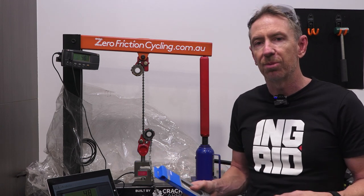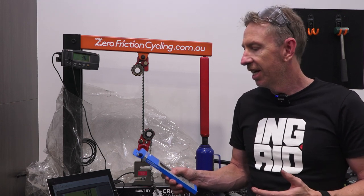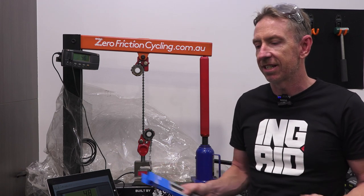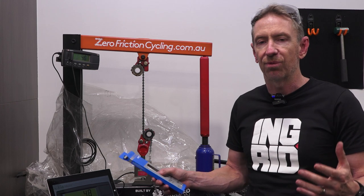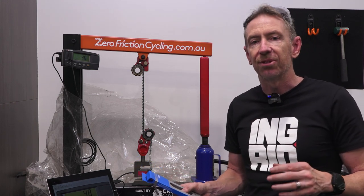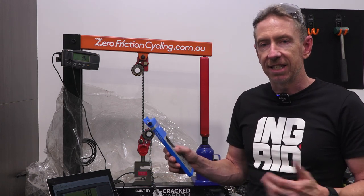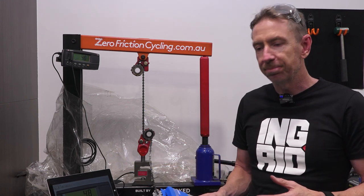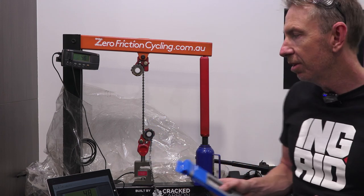So they just wouldn't bother with, say, the chromium plating and other hardening treatments or wear resistance treatments. So your e-bike chain, strong, but wore out super fast, and exacerbated by the fact that you're often riding off-road and people are running wet lubes, and it is just abrading through them in no time. Shimano chains at least have, in the 10-11 speed, decent wear characteristics. They're a solid chain and they're e-bike rated, so they've been the number one for a while.